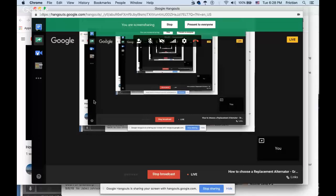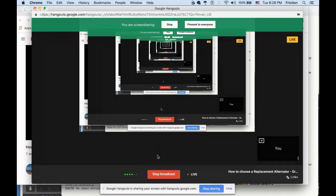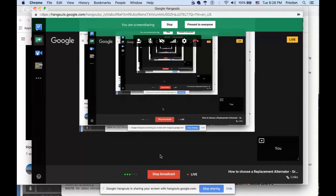So again, buy factory. Go for the efficiency, the same size amps you need. Don't upsize it unless you have to, and then upsize it just to where you need to be. You think about future needs, and calculate the exact future one. You can also trade off. You can go to LED lights if you've got a big enough vehicle and switch over to LED as opposed to all this other stuff. Halogen headlights versus HID headlights. All that stuff matters.